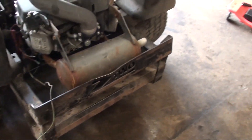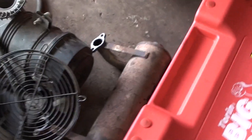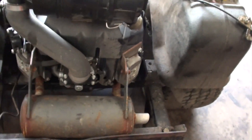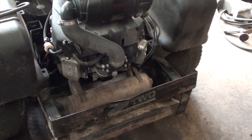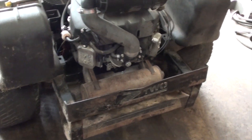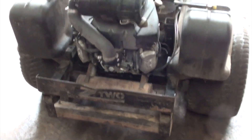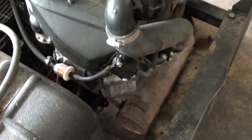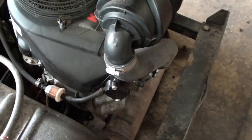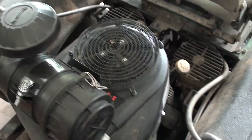That exhaust doesn't fit on this deck, so I needed to take the exhaust from the other motor and put it on here — had to take this back off and remove the exhaust. It's back on now and got the exhaust tightened up. I had to modify the stopper for the blade PTO clutch because the PTO clutch on the other motor was a different style — not a really big deal. Motor mounts and bolts went through, all tightened up. This clamp here is old and worn out and needs replacing. I sprayed the cylinders with WD-40, turned it over a bunch of times, then hooked up fuel and got it to fire. She's ready to go.